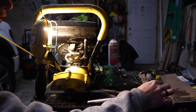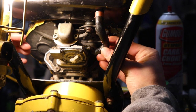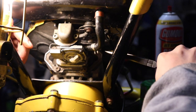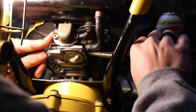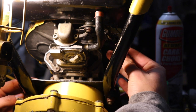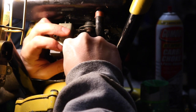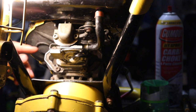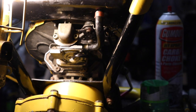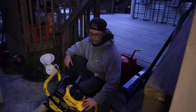Both sides are fully snugged up. This is the fuel in from the gas tank — take this and put it right on the nozzle, push it in, grab pliers, open this hose clamp, and push it all the way on so it doesn't come out. Next we have this very small hose that's just the drainage — same thing, just putting it on over this opening. Throttle works and pulls it wide open. The last step is we're going to do our adjustments and then run her. Priming it a little bit — it was definitely empty still.